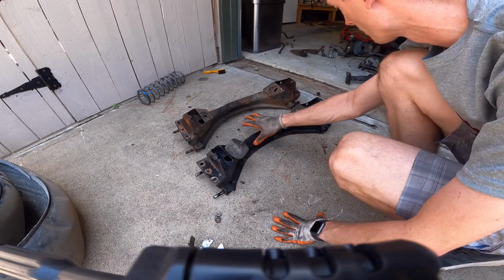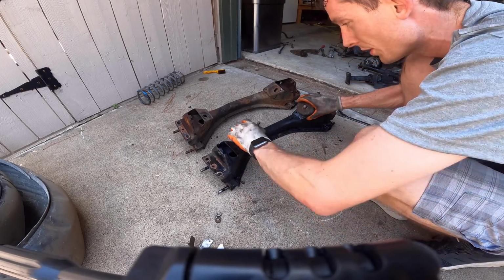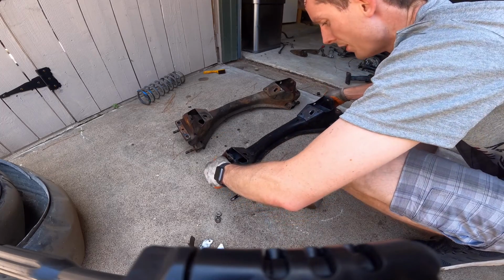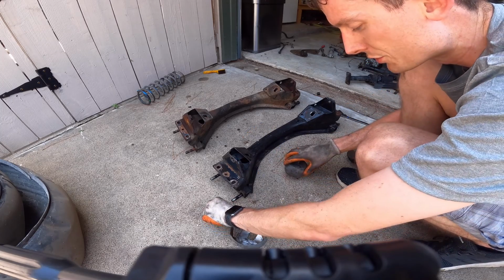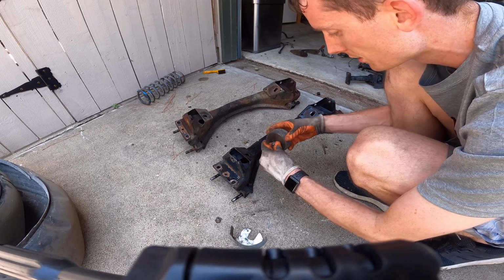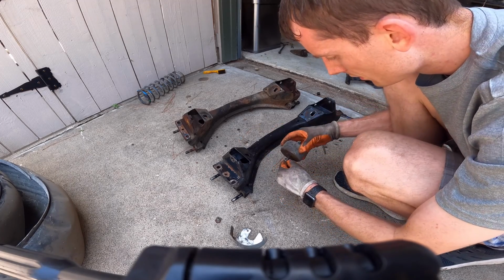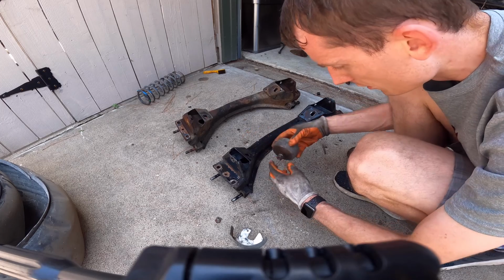So you see our old Crossmember compared to our new, lines up really nice. We don't have our motor mounts on yet, but what we're going to do is get to them through an access hole on the bottom. That's what these holes are here. Go straight to the motor mounts. But what I'm hoping to do is get them started by hand here. That way I don't have to try and feed the nut and lock washer all the way from the bottom. Just want to make sure I don't need the washer on there. Yeah, okay.